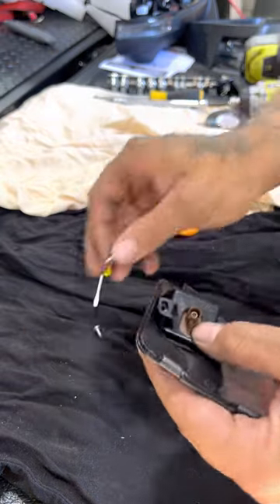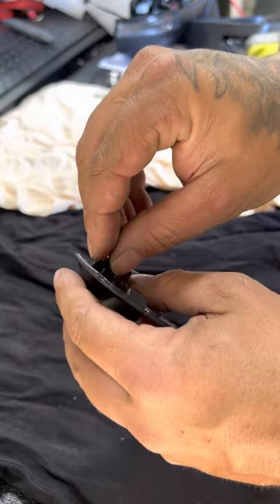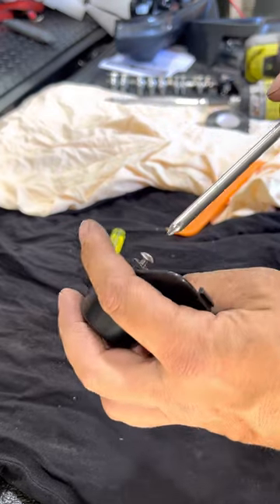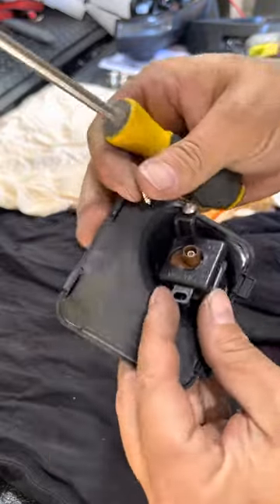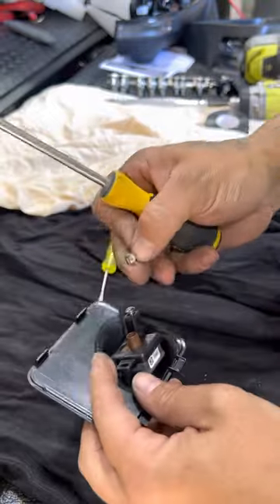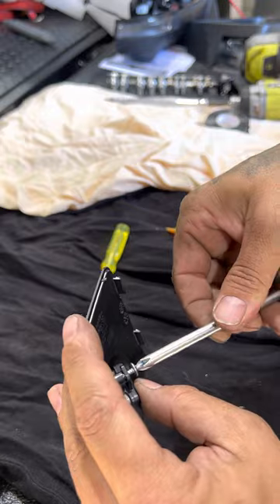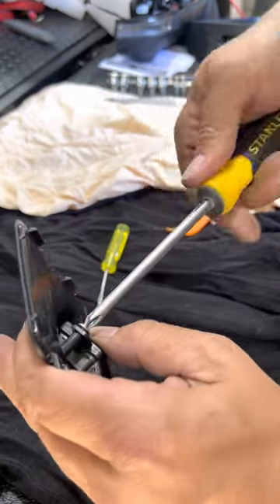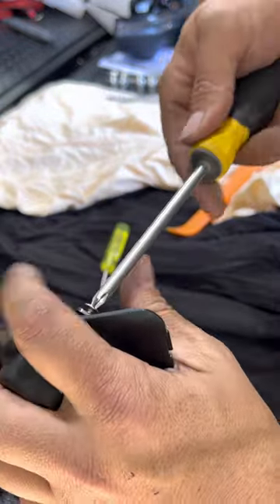They provide you with some small stainless screws. You'll see that this slot is elongated — that would be for forward adjustment so it needs to be calibrated. Just set it in the middle like I've done for the past week on my next-gen. I've had no fault codes, no camera blur, no warnings — my cameras match up front to rear perfectly fine. So just put it in and snug it down nice and tight, but not too tight — it's only plastic.